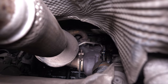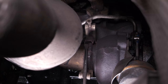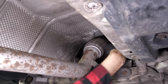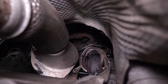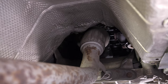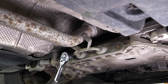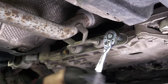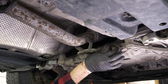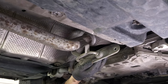Using a 5mm Allen key, unscrew the screw on the clip. Then free the screw and, with the help of a screwdriver, open up the clip to free the catalytic converter. You can now remove the clip. Using a socket wrench and a 13mm socket, unscrew the plate on the silent blocks which hold the catalytic converter in place. Once unscrewed, the whole catalytic converter will be free and you can remove it.